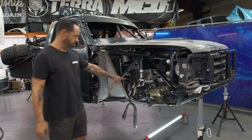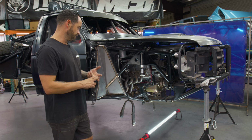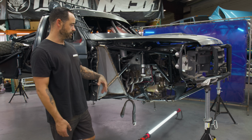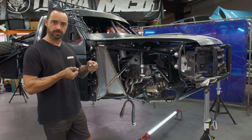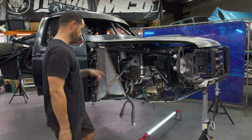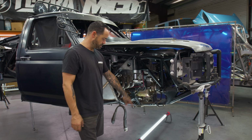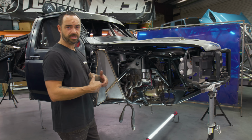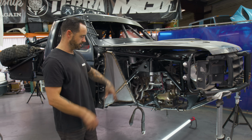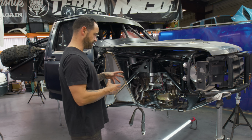All the pivots for the inner, the lower arm pivots, were all Delrin. We've machined bronze for those, so self-lubricating bronze, instead of that, where it's a much tighter, firmer situation, and the wear is dramatically decreased with those. So that's all done. All the suspension's been blown apart. We restructured some of the shock mount area on the lower arm because it was subject to cracking. So we cut off the repair parts they had there and fixed it, replated it. All that stuff's been resprayed with Steelite. So next update, you'll see that all complete.